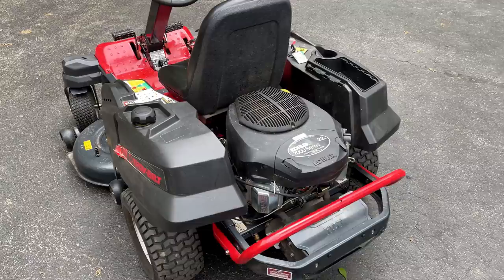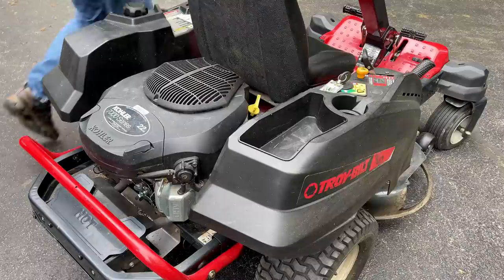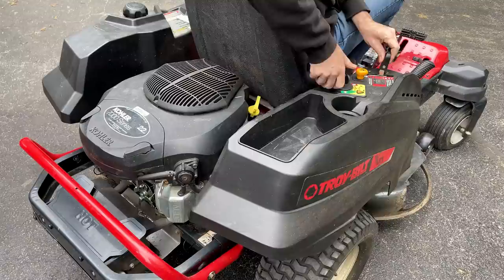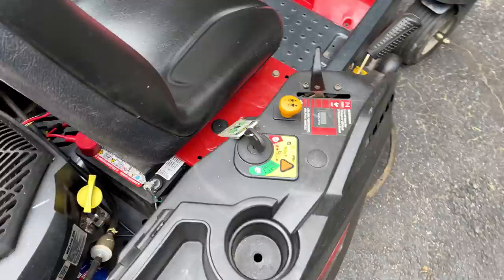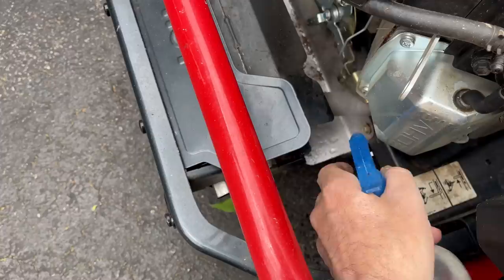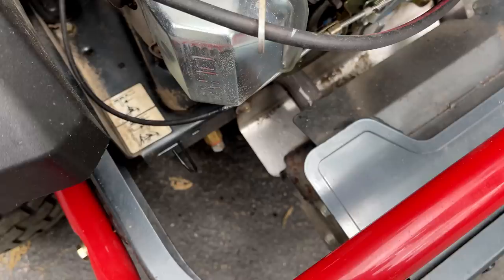So I think that's where we're gonna start. I'm gonna start the engine again. We'll let it warm up a bit, spray a little bit of water in each of those pipes, and see if we can figure out which cylinder is down. So we'll just give this pipe here on the right a squirt. And yeah, see, it's instantly turning to steam and I can feel the heat over there. So I'm guessing it's the left. Yeah, and that water, it's not steaming at all.